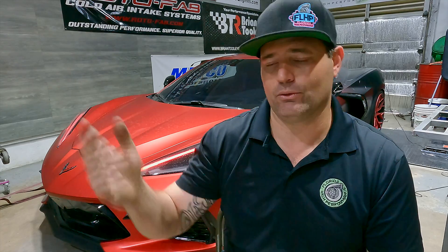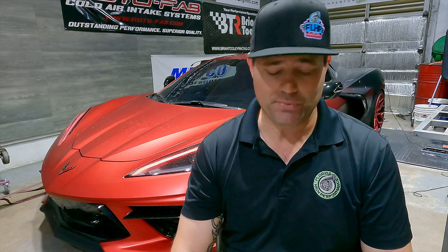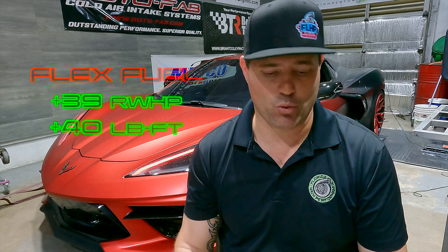As far as E85 goes, we drained all the 93 out of the car and put E85 in. This is pump E85 — we got it from a local station, and the highest content we were able to get out of it was E76. Anywhere from E70 to about E80 is about what we get around here, so E76 was fine. We felt comfortable with that and thought our results with E76 would be sufficient. We were able to get 30 degrees of timing on E76, which is awesome — quite a bit. Final numbers were 461 horsepower and 455 foot-pounds of torque — a 20 wheel horsepower increase and a 23 foot-pound torque increase over the 93 tuning.